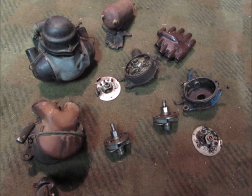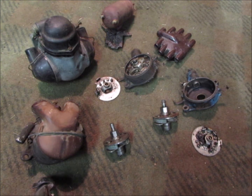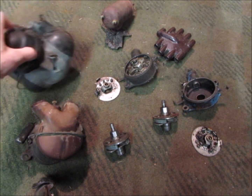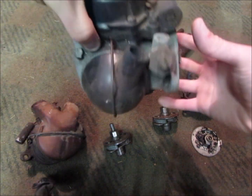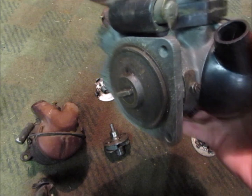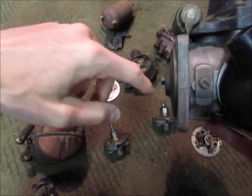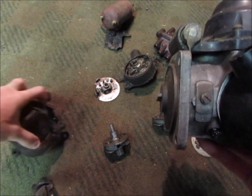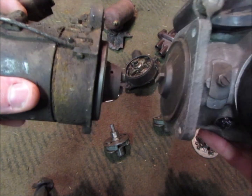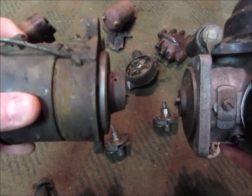The wonderful Flathead V8 ignition systems. I've got a couple different distributors here in various forms. This is the early Diver Dan one which they used from the beginning. You'll notice when you look at it, it's got a 3-bolt timing cover, and also a short snout compared to the later one, which has a longer one — so you need to run a 10mm or 3/8 spacer plate.